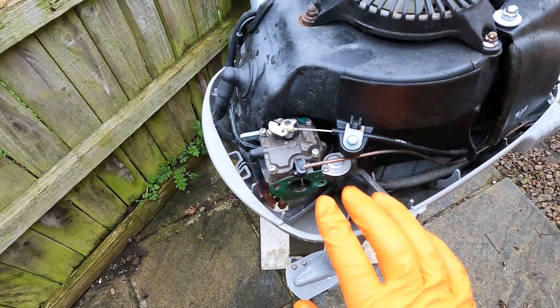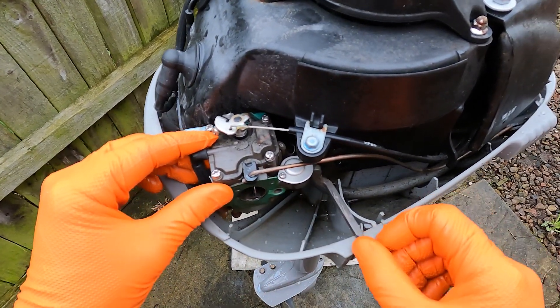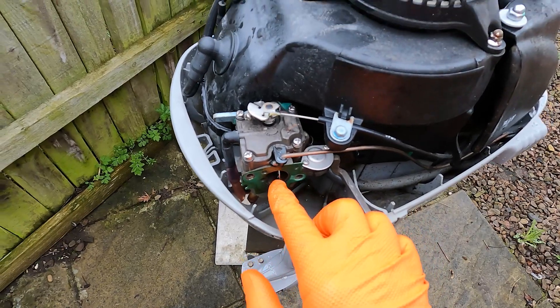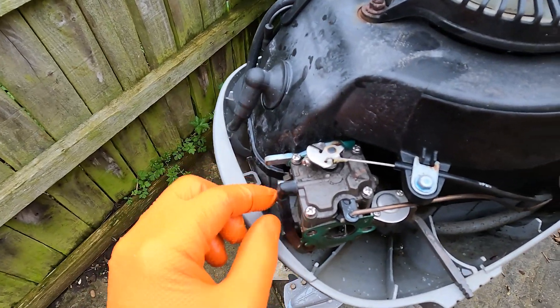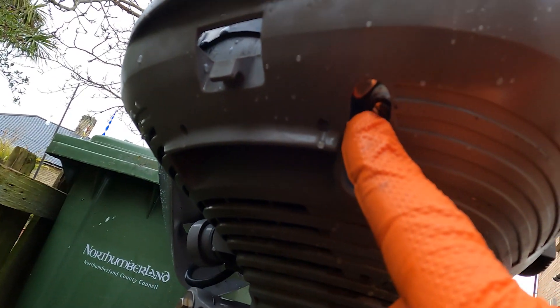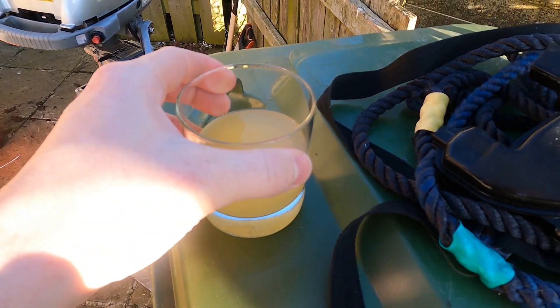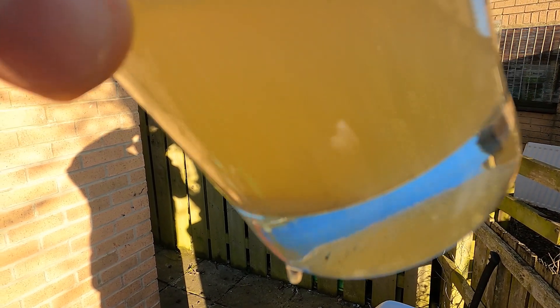Let's go over what these linkages are while we're here. This one at the bottom is your fuel on/fuel off. This lever connected to this butterfly plate — that's the choke. And this one here is the throttle. This is just a vent. Underneath you've got a little screw that's a drain tap — the customer says it's corroded and damaged, and I agree with him. I've drained the fuel out. Right in the bottom there is a sample of the fuel — it's full of water and dirt.